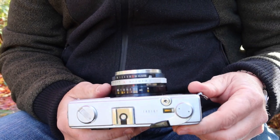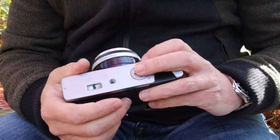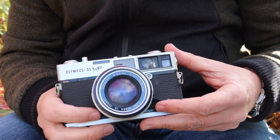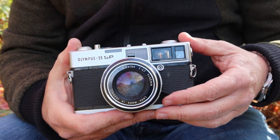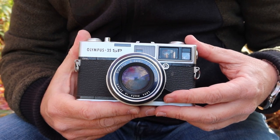Other than that, it's quite a reliable camera. The shutter is fully mechanical, so if you don't have a battery you can still operate it — the battery only powers the meter. If you have one of these cameras with a non-functioning light meter, which is unfortunately quite common, you can use a handheld light meter, a spot meter, or a light meter app on your smartphone.